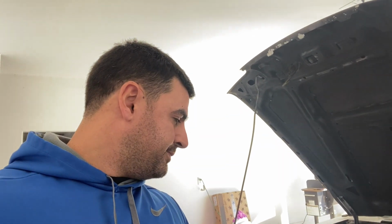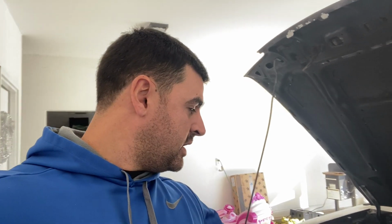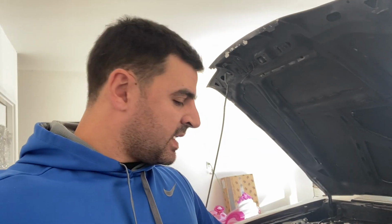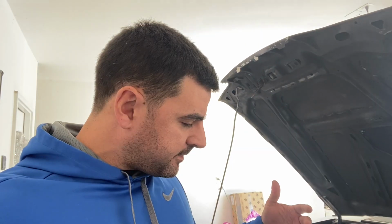I mean, this is the way to do it, this little handheld transfer pump. I got it from Tractor Supply. I think it was maybe 10 bucks. And no more trying to drain antifreeze out of that little petcock at the bottom. It's completely pointless. I could suck enough coolant out of this that I could even do the head gaskets on this car with that little pump. So definitely highly recommend getting one of those if you're going to do some sort of job where you need to drain the coolant. Save yourself the mess, and it's actually quicker too, I think, honestly.